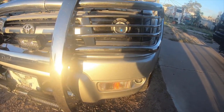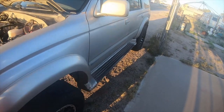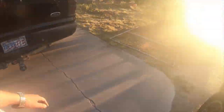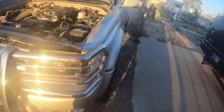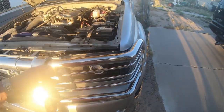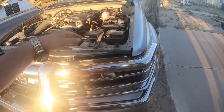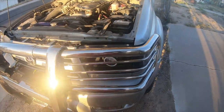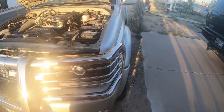The orange wire allows the halos on my headlights to flash when I turn my hazards on, and also alerts people when I'm turning — so they blink at the same time. I have the amber switchbacks — the switchback is where I can have any color on my front halos. I only wired the front halos, so the rear halos stay whatever color I set them to. I can always wire the rear halos to the blinkers later down the road.